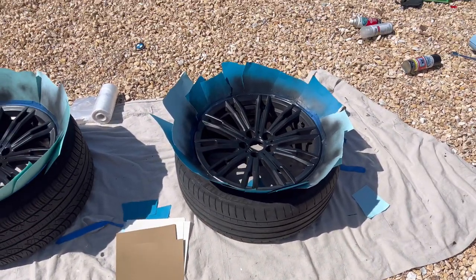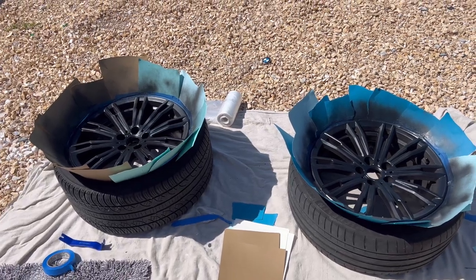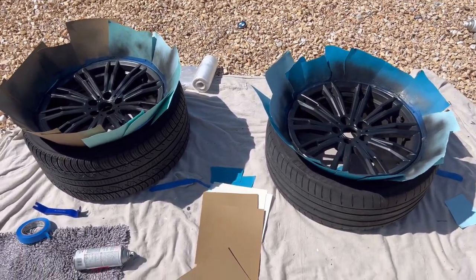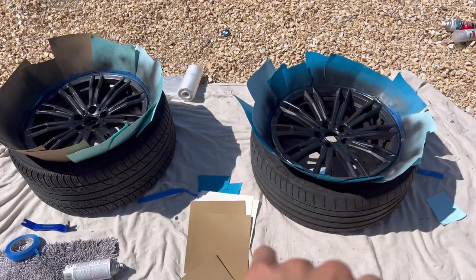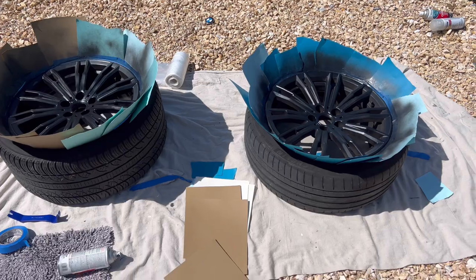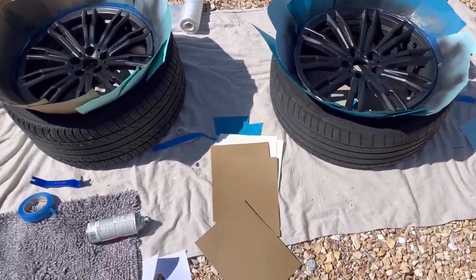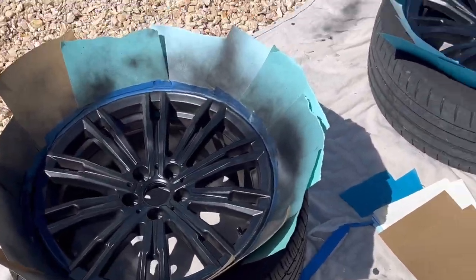Since this is just a touch-up, I did a light sand and I'm just repainting it and re-clear coating it because it got really faded. If you want to do a more intricate job, do a lot more sanding, acetone clean it, wet sand it — you can also fix cracks. These are all things I've seen from ChrisFix's video, so go check his channel. I'm just doing a quick and easy paint job, but overall it looks good for the first coat.